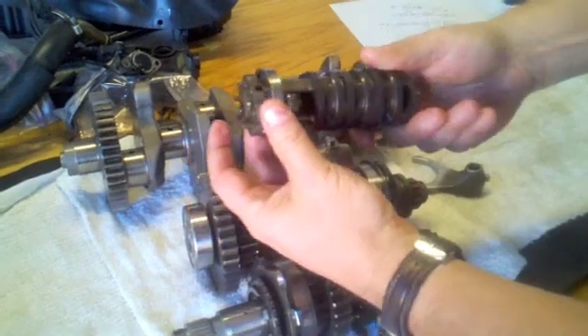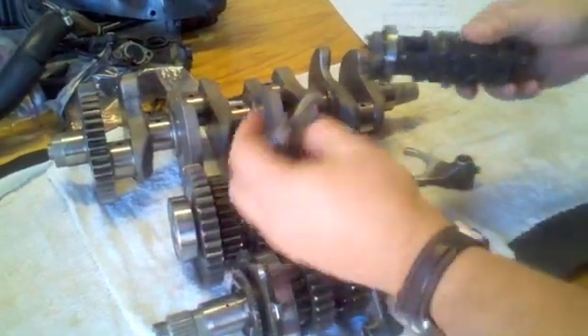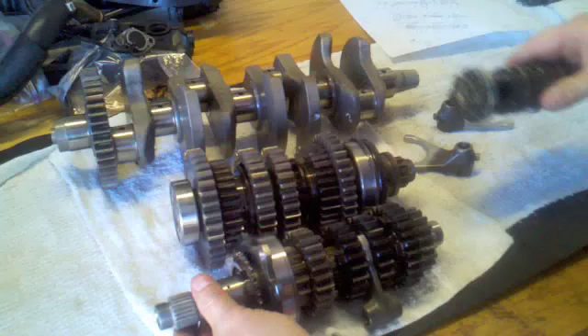When I click the outside shift lever, it causes this drum to spin. When the drum spins, the shift forks have a cam on the bottom that falls into these cam followers, and it forces all three shift forks to move right and left together. That's essentially how we get power out to the back wheel.